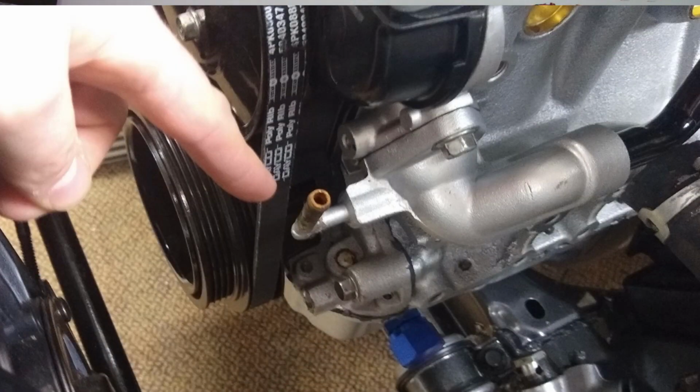So I use -6AN hose for all my coolant feed and return lines. Basically, I have my 2 fittings already in my turbo. Then on the actual engine side of the connection, I am tapping at the back of the head by my coolant reroute. There's a nipple coming off the head there that is a 5/16 nipple. Also down at the mixing valve is where I believe my return goes. That is also a 5/16 inch nipple.